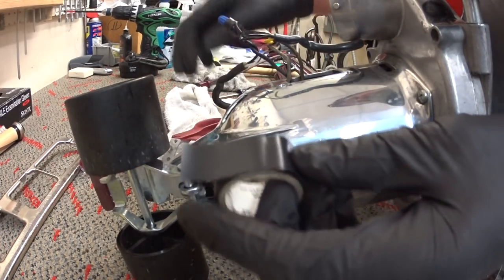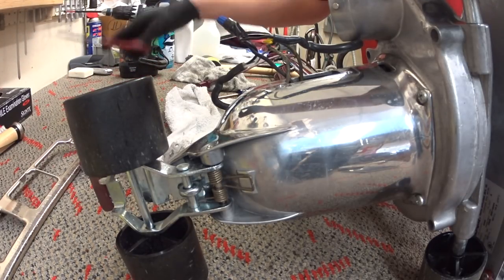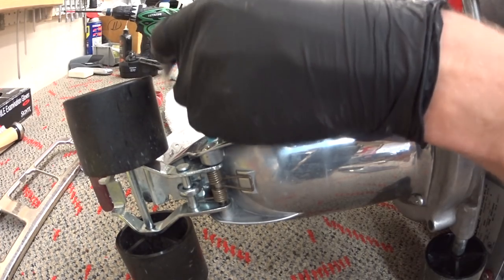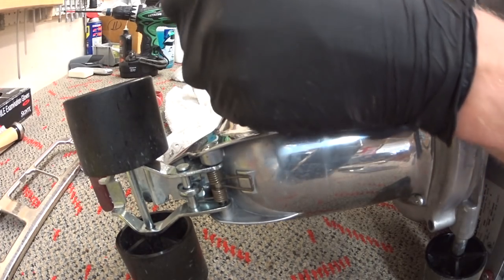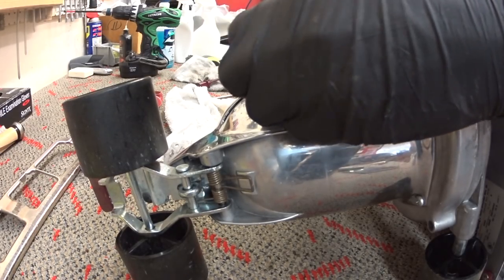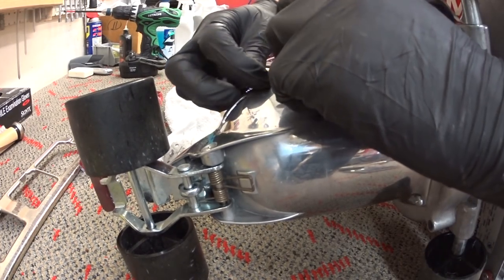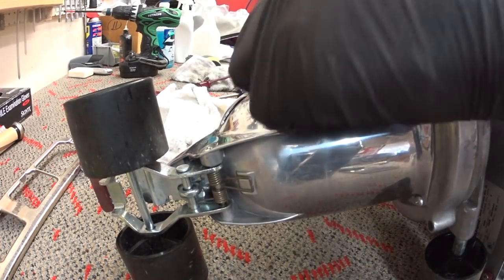One other thing, I've emphasized this before, but if you've got wire nuts that are not going to be in a junction box, that are going to be in an appliance, moving around and vibrating, always put a little bit of electrical tape on them. This acts as a lock tie so they don't come loose. The last thing I want are these wires coming loose and grounding out on this aluminum housing, which would conduct electricity very, very well. And I don't think my customers would appreciate a zap. But I don't know, maybe other technicians are upset at their customers and they purposely do that. I don't know.